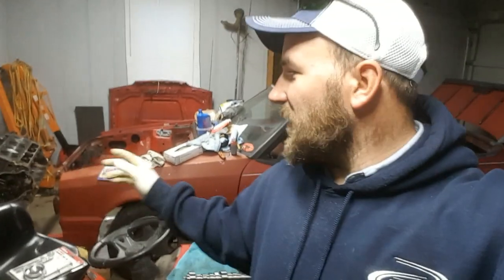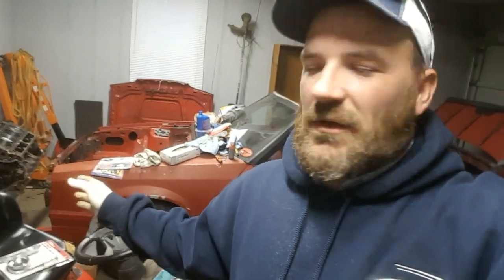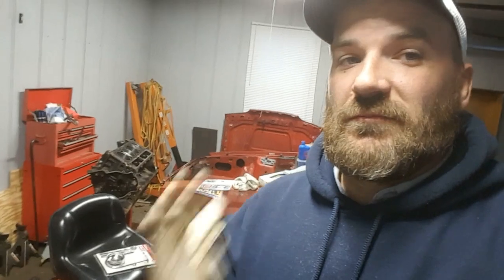We'll go over the torque ratings for the rod bolts. Right now they're just snugged on. They're not tight. We'll go through the torque ratings on those, get them all torqued down on camera. We'll do the next 4 pistons off camera. Windage tray, oil pan, timing set, all that good stuff later on. Not much more left, y'all. It's going good. So we'll talk about the valve springs and stuff next time too.